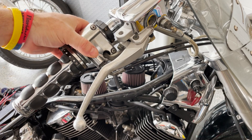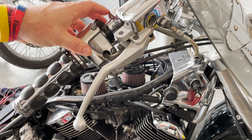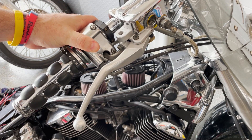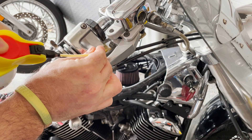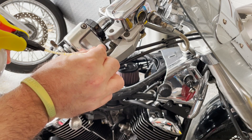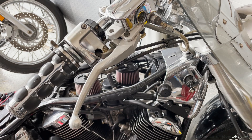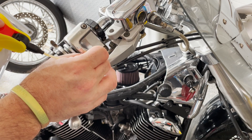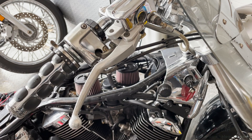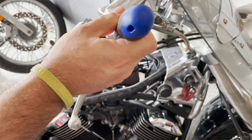I rotated the assembly back up and put the other screw back in to give an easier angle to work on that bottom screw. I try spraying some oil into the screw — I realize it's probably futile because the threads are all the way on the other side — but I figure I'll give it a shot. The screw is in so tight it's probably not letting any oil past the head. One more round of percussion is attempted.